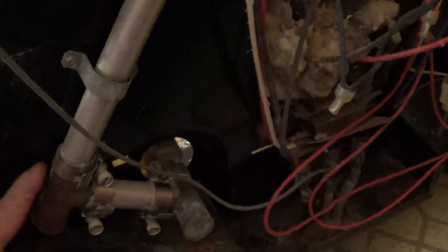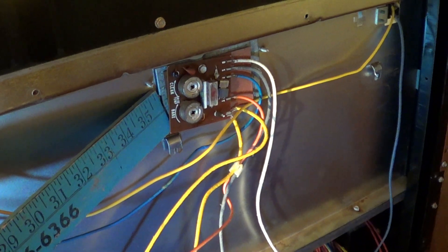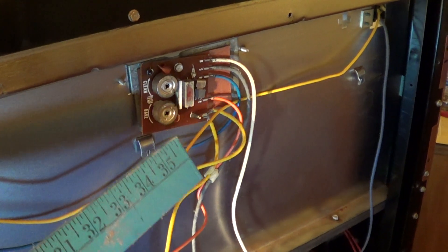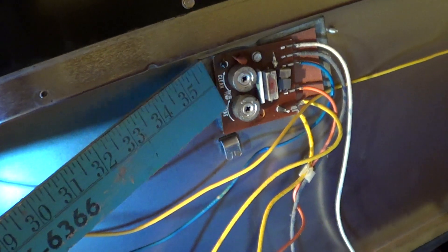From the bottom tray the magnetron goes through here — about four inches, with a 90 degree elbow — and feeds the antenna. This is the back of a double oven. That's the circuit board for the solid state control on the lower oven, common on a General Electric. It's got two pots for bake and clean, and it's driven from the front control. It's got a 29 ohm resistor for the temperature, and then it goes through on the board.